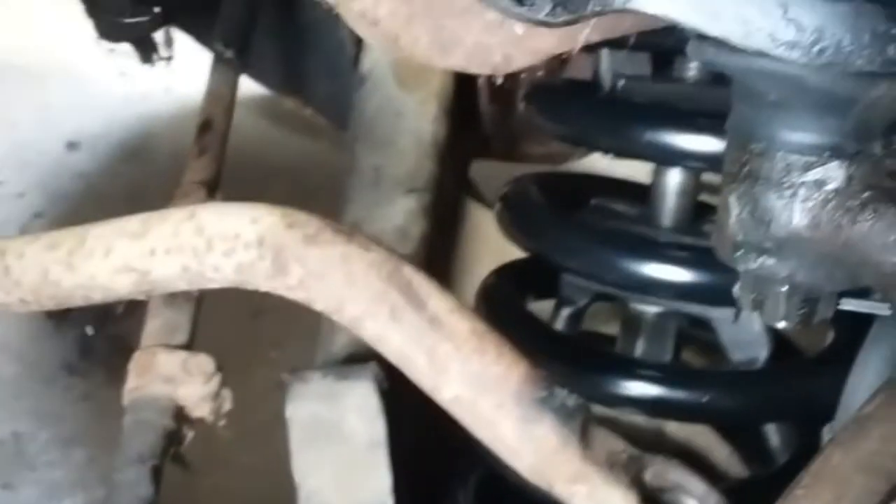You want to make sure you have your steering disconnected because that makes this a lot easier. And that's going to be one of the last things you put back on as far as reassembly. The last thing you do is grease it. So cotter pins are in, everything's tightened down and locked down. Still don't have the steering put back on because now's the time to do the sway bar end link while you've got access to it. Make sure you lubricate this too because they have a tendency of rotting out. But if you put something in there that won't let the water sit in there, it doesn't have that option. Plus it'll keep it from doing any squeaking. So put that in first and then hook up your steering — lube it up and should be good to go.